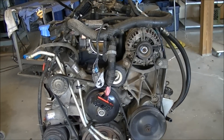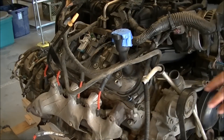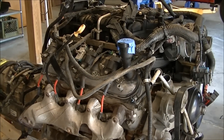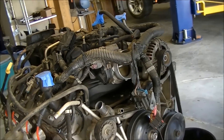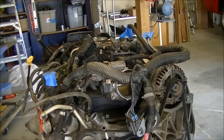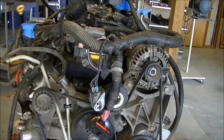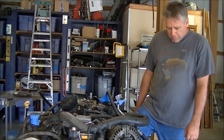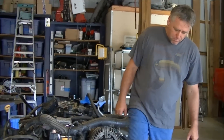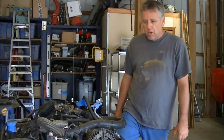That means we're going to have to take the wiring harness off, most of the hoses, and probably a lot of the accessories on the front, just to kind of get it in a more compact package so that when we go to put it in the truck we don't get hung up on a bunch of stuff. This is how the motor came shipped to us — unwrapped out of the bubble wrap out of the crate, and put up on a solid working platform so we can move it around and reach all the way around the motor.